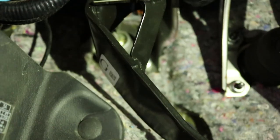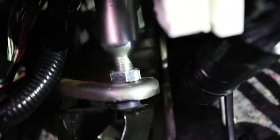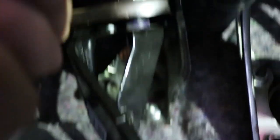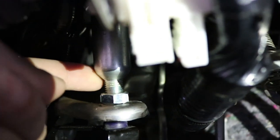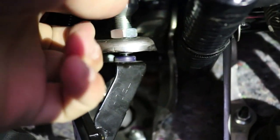If you look inside at the clutch pedal — here's the clutch pedal, if you follow it up, it's kind of hard to see, let me get my phone for some light. If you're looking at the clutch pedal, you see that silver pin, that silver cylinder right here — this nut is a 17mm. If you crack that free, you can spin this out.